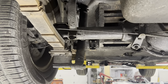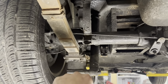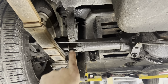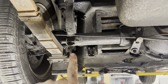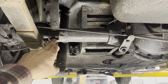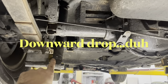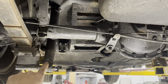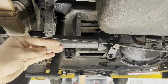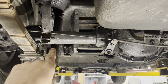The reason that exhaust system broke where it did was because right after we worked on this thing, he broke a check strap. The reason why that's important is this limits the axle movement up and down, keeping you from overextending the shock absorbers — which, of course, these are not stock — but also keeping the exhaust from being hit by the rear axle.